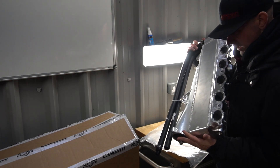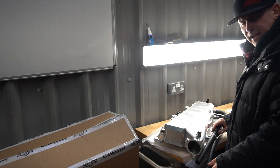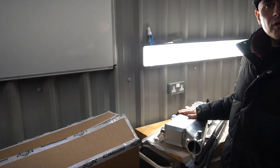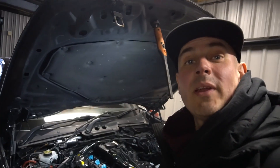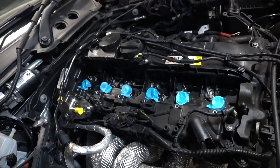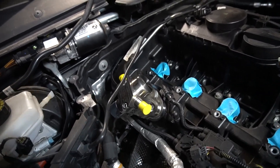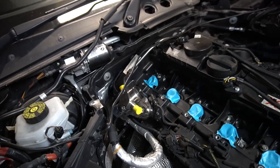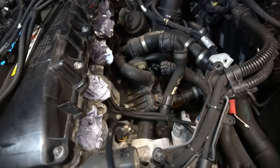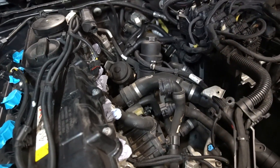This is a work of art, this thing. So I've basically just been setting up all the fixings and plumbing. These will be trimmed down to the correct length once we offer it up to the car. Map sensors in, all the bungs, fixings, etc. Meanwhile, Will has been busy on the fuel system. While I've been on the manifold, Will's been busy in the engine bay. As you can see, the injectors are now out — the originals — and the Nostrums are about to be installed. He's also put the new Dorch DS25 pump in. We're going to put the rest of the lines in once the injectors are done, and then we'll be moving on to mocking up the manifold, making sure we've got our water lines and charge cooler lines for the CSF charge cooler trimmed to the right length for the factory pickups.